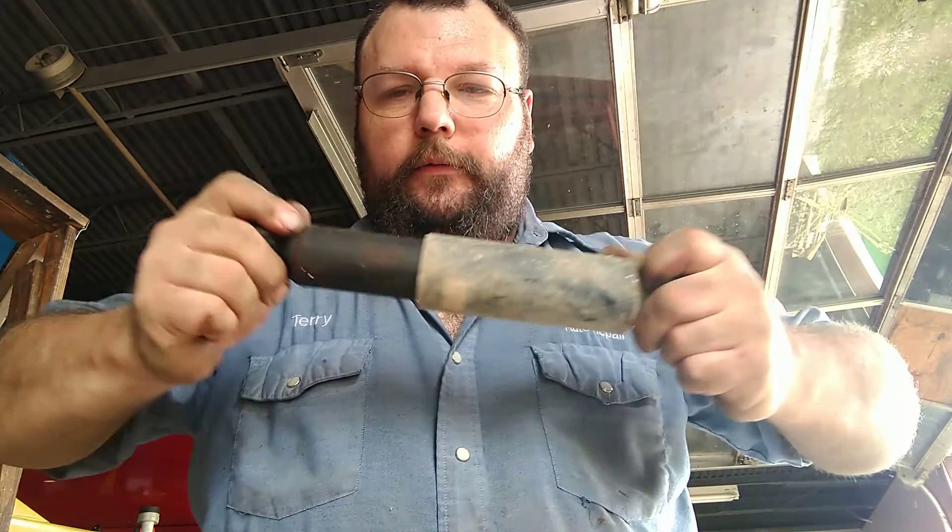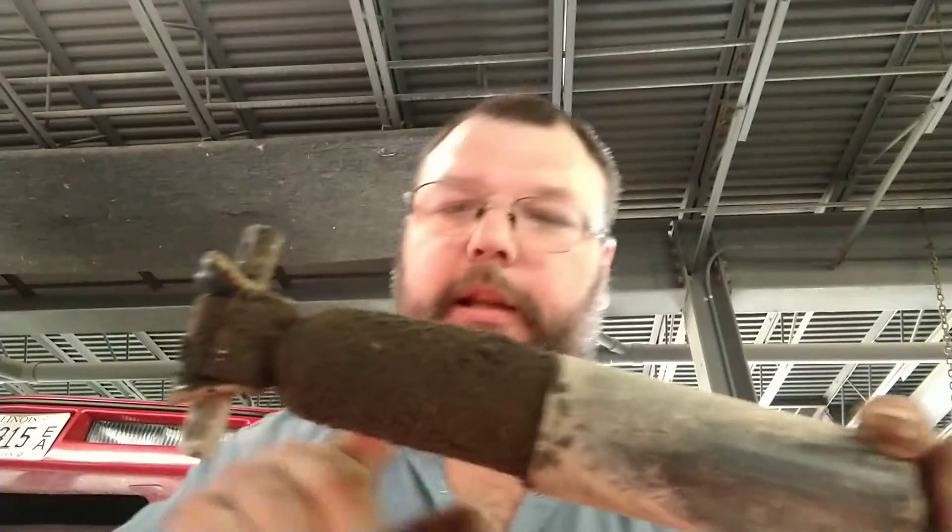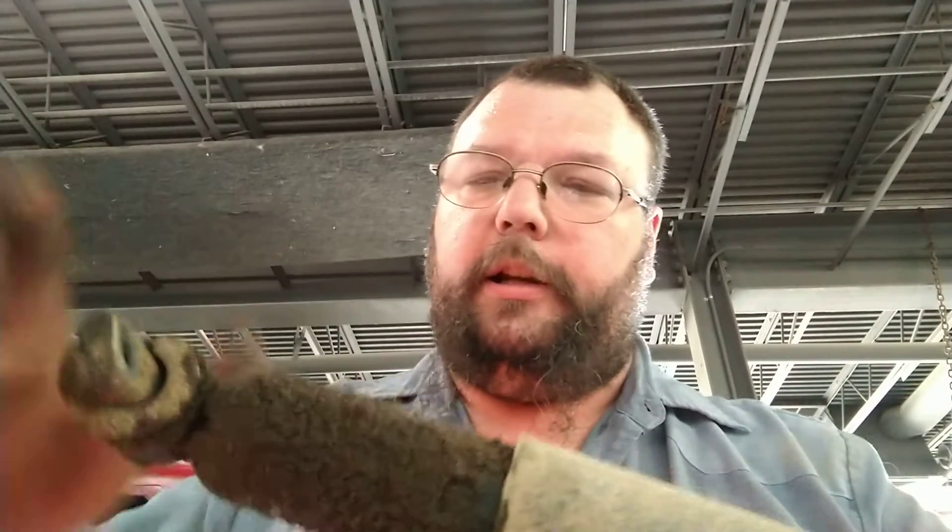This car just sat still most of its life. It just gets to where it sat in one place so long that it doesn't seal anymore. The shock itself is not all that bad. I'll grab you a front shock that I just pulled off — there we go. You see it's leaking too, got dirt all over it collected on the oil.